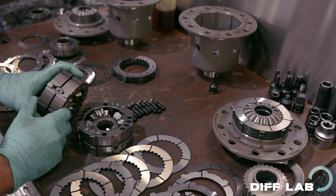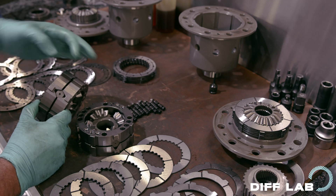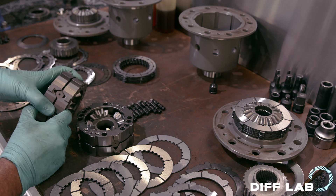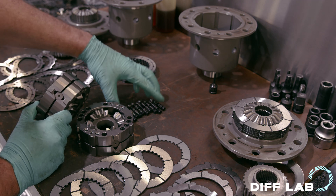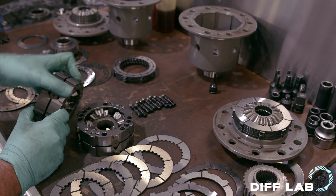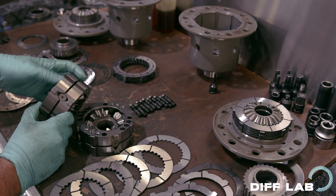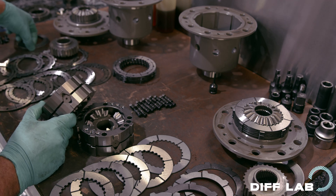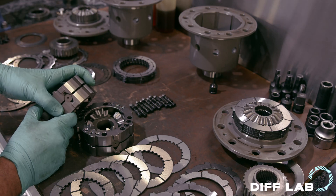So you can imagine in a vehicle: when you apply engine power, you are fighting against these springs to separate these plates. There's a certain amount of engine torque you would need to apply to achieve any lockup at all, and that amount of torque would need to be greater than the resistance of all of these springs. The moment you are not applying that much torque, these plates are being sandwiched shut by these springs, reducing your lockup to almost nothing. Not quite nothing, because there are end springs always compressing the plates a little bit — one at each end — but very close to nothing.